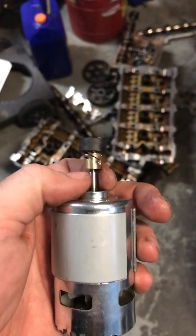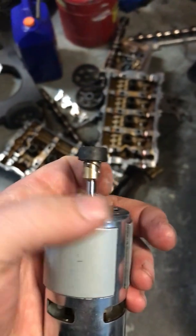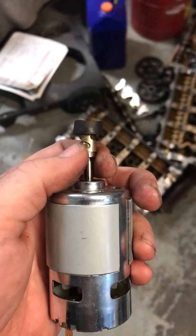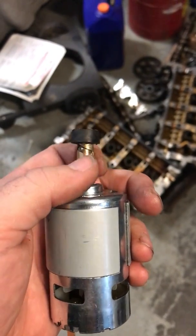You don't want to put any oils or lubricants on them, as it will cause the Bendix clutch to collect dirt and grime, which will build up in there and not allow this thing to move as appropriate.